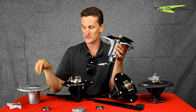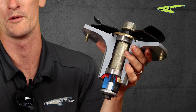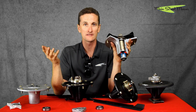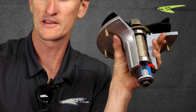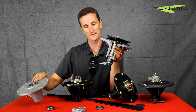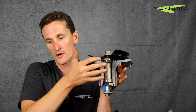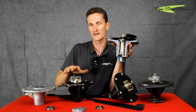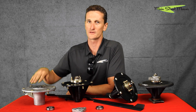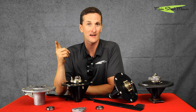On top of all that, this housing is cheaper than any of the previous designs. In the history of this spindle since 2020, we have never had a bolt we couldn't get off. We've been replacing far fewer spindle bearings. If you catch it early you can just put a new bearing in; if not, you can replace just this piece here — not a fully complete spindle, so you reuse the labyrinth piece, umbrella, and top pulley. It's about $140, a lot less than some earlier designs that got up into the $400s.